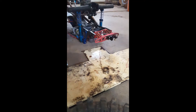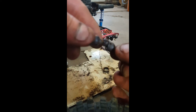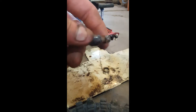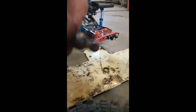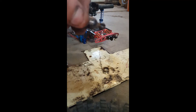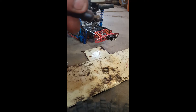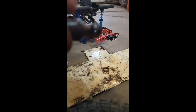You see those holes there — that's where your pin is going to go through. When you get your drive shaft off, these really need to be greased. You get a pin put through there. What happens is these wear out over time — see the holes? They just wear out.